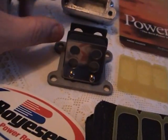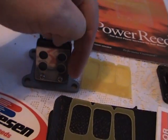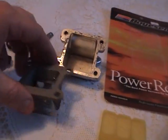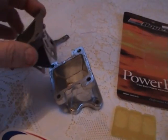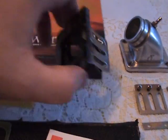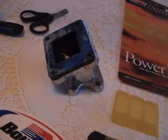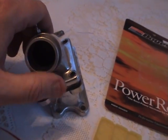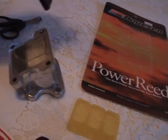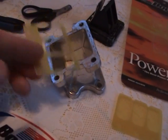You have to remember on these CT type intakes that you have to get them pretty close on this side and this side, so they'll go down into the mouth of the intake — they can't be too far off. See how it goes in there like that? This other one has a bigger intake. What bothers me is that my engine is 120cc's and this reed is a huge reed for a huge intake, and I can't go that big.